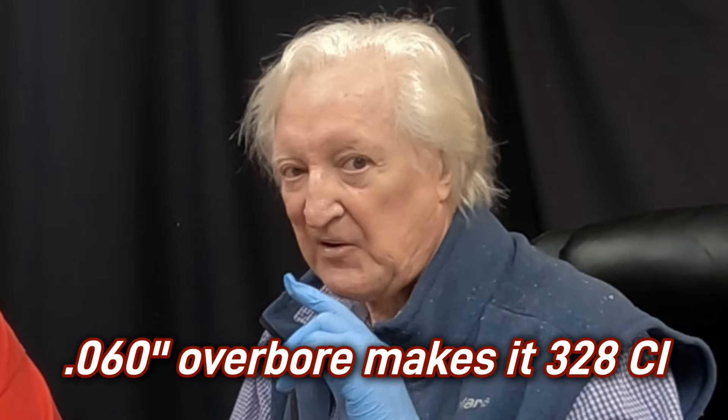An overbore is worth more than just the extra flow or the extra cubic inches. Check this out — this paper represents a 4.030 bore, which at 500 lift, that cylinder head flowed 252 CFM. Doing nothing but putting it on a stock 318 bore size, which is 3.91, at the same 500 lift value, it shrank to 225 CFM. That's over 10%. With the small bore and the shrouding, you're losing something like 6% cubic inches and 10% flow — could be as much as 50 horsepower. So there's our problem.